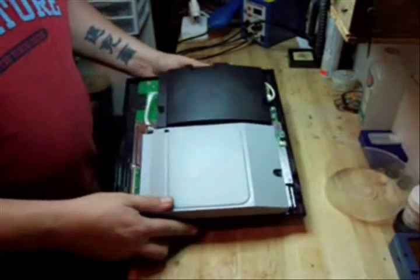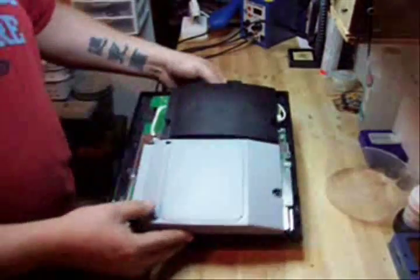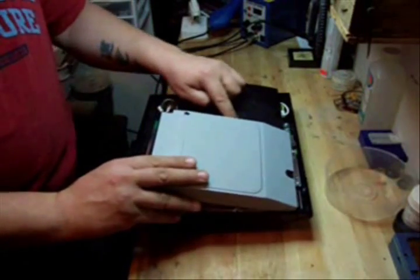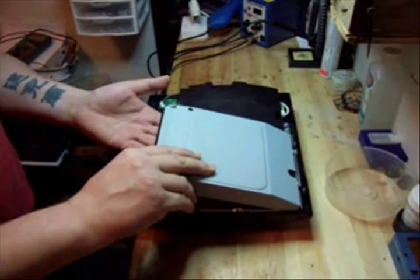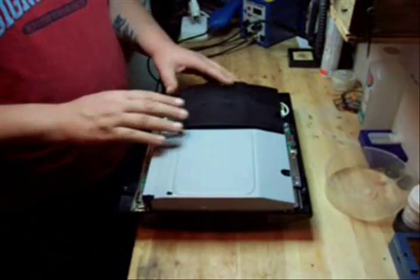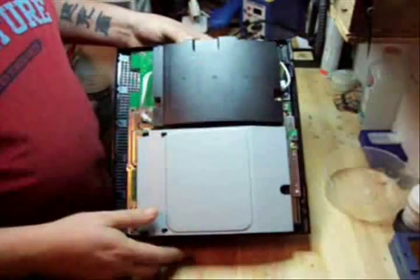What you're going to need to do is take out five screws from the black power supply. If you lift up the unit, you unplug the Blu-ray drive and lift it up, you'll see it has a little tiny ribbon cable underneath with a piece of tape on it. You can't really get the ribbon cable out without bending or possibly breaking it. So the safest way for this particular model is to pull out the five screws from the power supply.